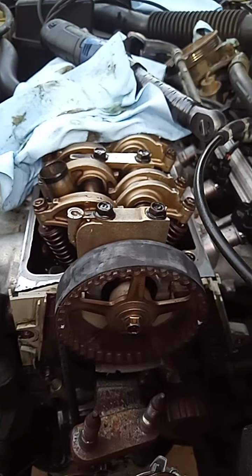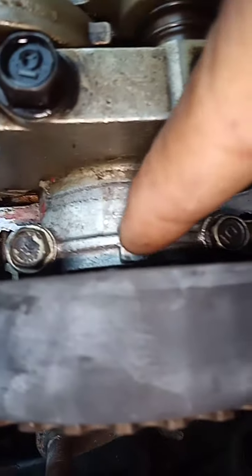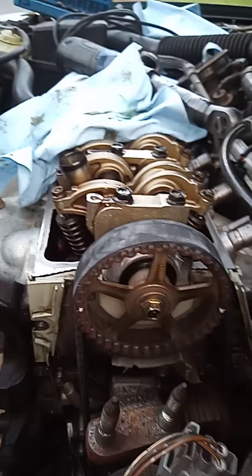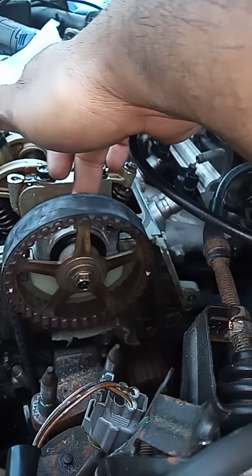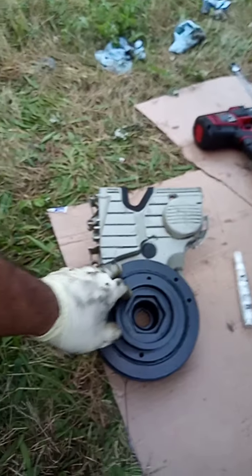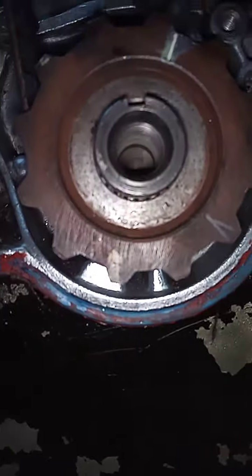This other mark here has got to line up with the notch back here. See this notch right here? It's got to point out — if you look here, it's got to point out perfectly. If you look this up, it's got to point out with this notch in the back. So it's got to be at 12 o'clock. Now, I have the crankshaft position pulley out — I already showed you that. That's got to be at 12 o'clock.